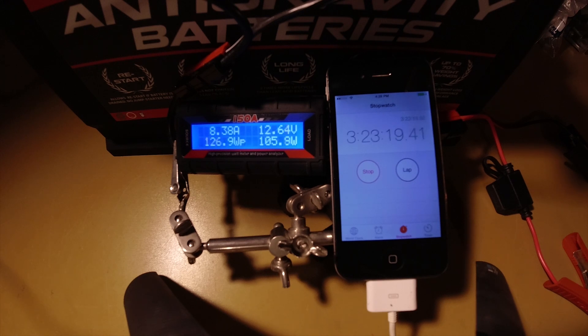It's important if you are out camping and for some reason you do hit this limit — when you turn your truck back on, hit the little key fob button, make sure you start your truck and run it for a while, and then figure out why you were drawing too much power. You don't want to just keep pressing the emergency backup and depleting that power. Another benefit of the BMS is battery life, which is estimated to be upwards of eight to 10 years. That of course depends on usage of the battery and conditions that it's being used in.